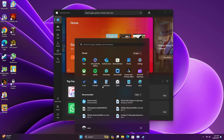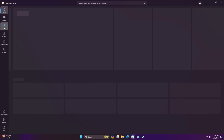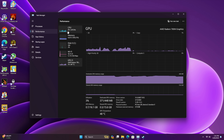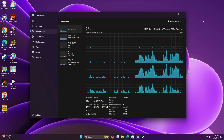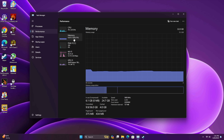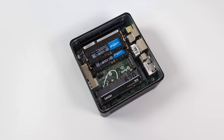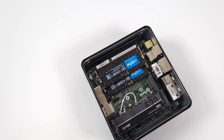Overall, seeing some really good performance out of the ASRock 4x4 8840U, and it does come down to the optimizations they do. We've got balance mode and performance mode — if you want to get the max out of it you're going to go to performance mode. But like I mentioned, you really don't need performance mode if you're just going to be using this as an everyday desktop. We just wanted to get that TDP up in performance mode so we can get the clocks up on that GPU. Most of the time for web browsing, 4K playback, and even some video editing it's really not going to be that necessary. I will have at least one more video coming up with this mini PC — we've got that extra M.2 slot, so we're going to be adding an Oculink eGPU. It does have USB 4 up front and we could always plug in a Thunderbolt eGPU, but we're just not going to get the kind of performance we could out of an Oculink setup.